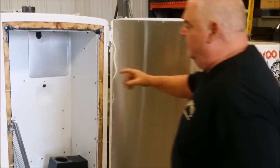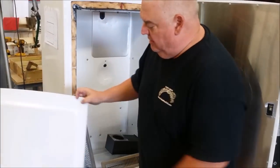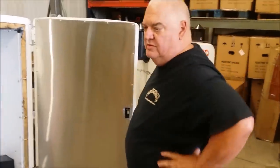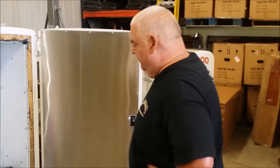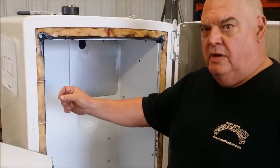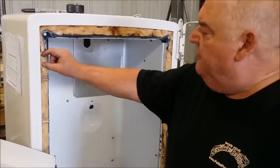What we did is we took off all the plastic. There's a plastic edging here — we pulled that out. On the door there was a plastic door, and what we did is we covered it with some stainless steel. You could use some regular 13-gauge, as long as it's not galvanized. Once you pull the plastic out of here, you can use some aluminum flashing for housing — it's an angle one.